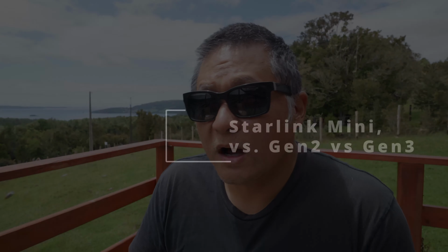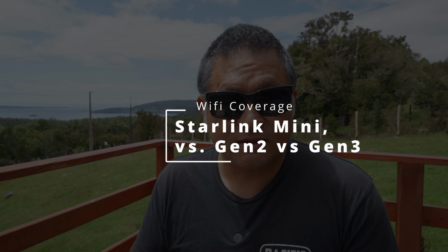The high end of that power consumption has to do with the snow melt capability. In my use case, I always have the snow melt turned off, which is why it doesn't use nearly that much power on the high end. The Gen 2 and Gen 3 dish have a melting capability of 40 millimeters of snow per hour, while the Mini has a melting capability of 25 millimeters per hour. The Wi-Fi coverage for the router is another big difference here.